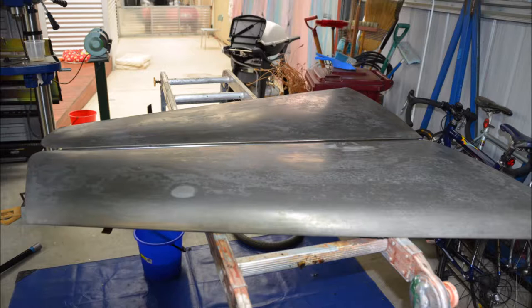In this shot you can see a small round patch where the metal is a different colour. I think what's happened there is it's been repaired — it's actually a bit of what's known as lead wiping, where they've repaired a small dent in it. Not sure if that would have been a crash repair or maybe even done in the factory. You can also just see some numbers on the bonnet, which I think probably refers to the grade of steel that was used.